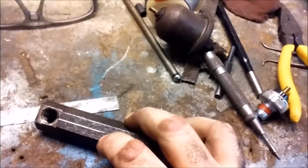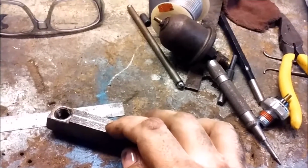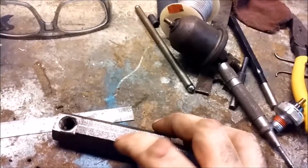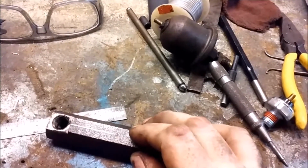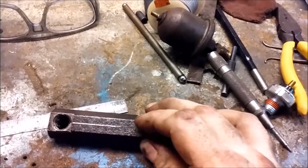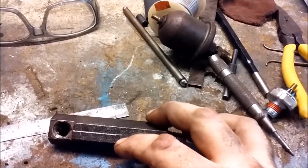And I'll use the center drill, pilot drill, and quarter NPT tap drill, which is 7/16 of an inch, I do believe, which I will confirm. I have a chart around here somewhere for it. So we'll confirm that, and probably use the drill press to start the tap at least. That way it's centered. I don't have very good pipe taps. They're not super high quality. They're actually from Harbor Freight, so they're pretty bad quality, but it should be good enough for this.